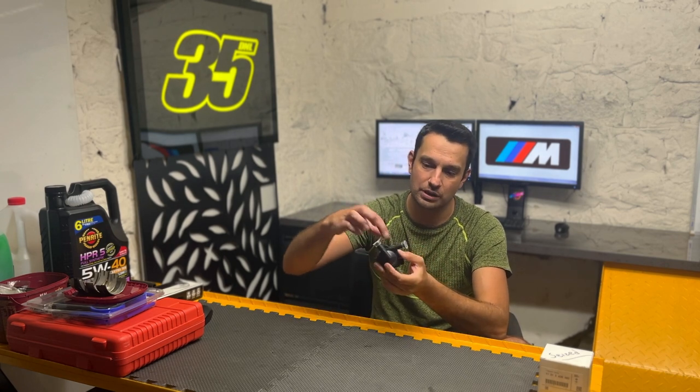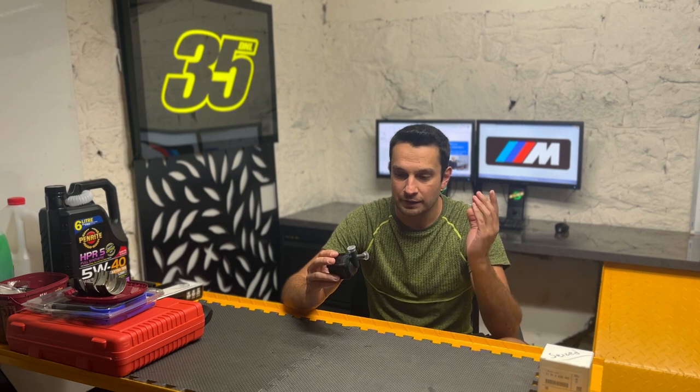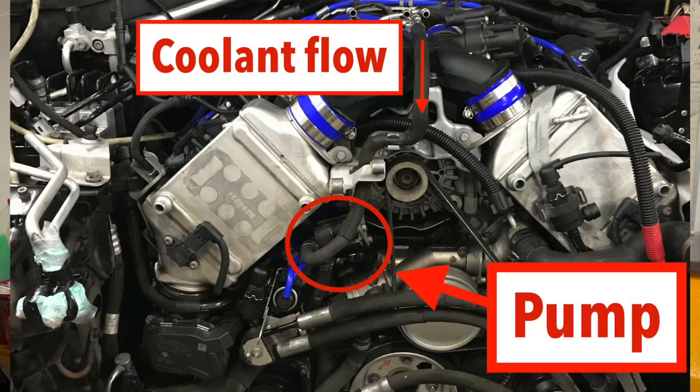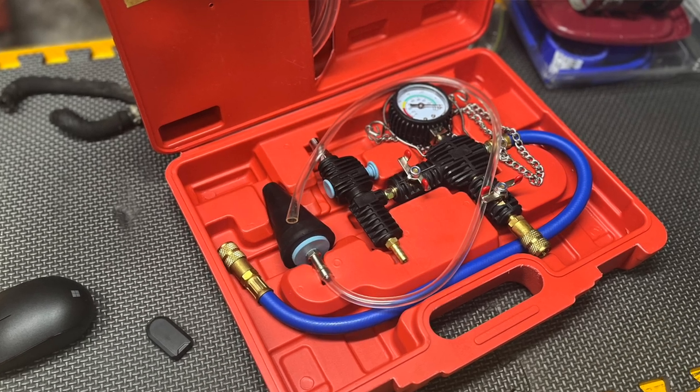The design of this pump is not really perfect. It has errors in the direction of coolant flow. With most engines, coolant travels upwards so any air bubbles are automatically pushed up and go back to the reservoir. But in this case, this little pump sits in front of the engine and is actually pushing the fluid down — pulling the coolant out of the turbochargers, into the pump, and back into the engine. There's just no way this thing is going to bleed itself. If you don't vacuum-fill the coolant system properly, these pumps are gonna burn out again and again.